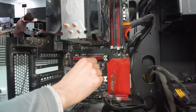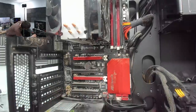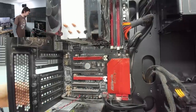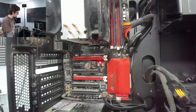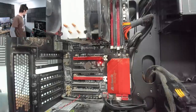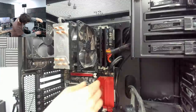We'll switch back to main BIOS just so we can keep testing under the same circumstances. I need a beep speaker — I'm going to go find one. Let's power it up with the beep speaker plugged in and see if we're getting any BIOS beep codes. Three beeps — this is going to be memory. Beep codes aren't always memory, but most of the time they are. Let's pop out the memory modules.